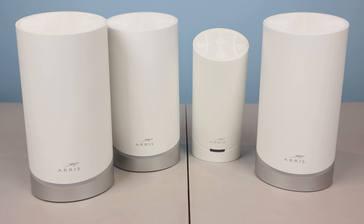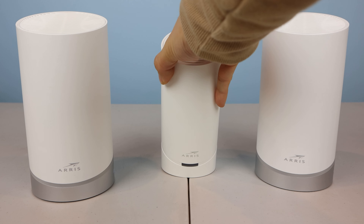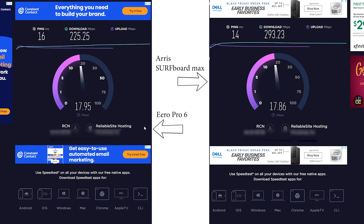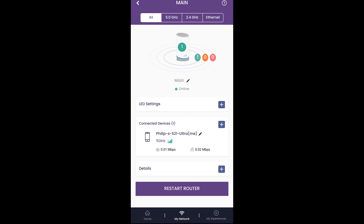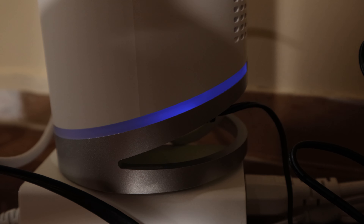The ARIS Surfboard Max uses a tri-band system with a dedicated wireless backhaul channel. The two-node system covers up to 5,500 square feet, but is expandable by adding one additional node, as the system maxes out at three nodes. If you want wired Ethernet ports at each access point, I recommend using routers as the child nodes, which would give you two Ethernet uplinks per node, while the plug-in satellite would only support wireless connections. In a side-by-side comparison of network speed, I was surprised to find that the download speeds of the ARIS compared to my previous Wi-Fi 6 network were consistently almost 50% faster for downloads. Even though we aren't on the 1GB plan from our ISP, the ARIS system was able to deliver speeds close to the max bandwidth level that we do subscribe to in almost all areas of the home.